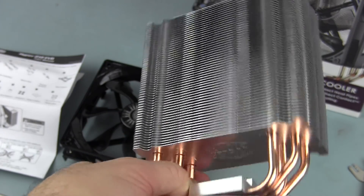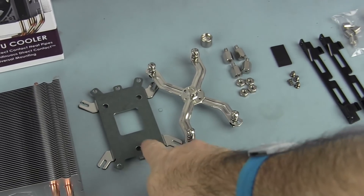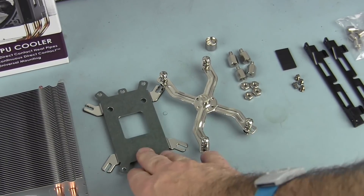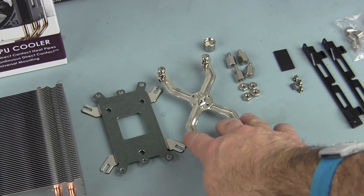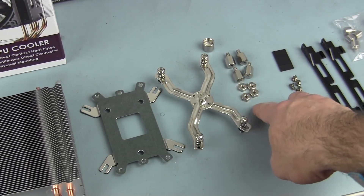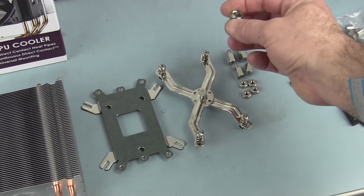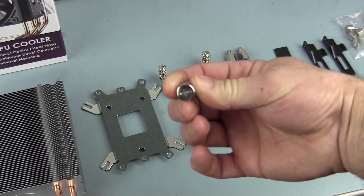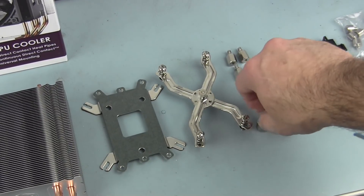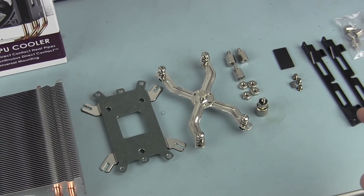Here are the key mounting pieces. This is your base plate that you mount to the underside of your motherboard. There's a bracket that sits through the CPU tower and holds it down to your motherboard. You get four standoffs and nuts to secure the mounting plate, and they also provide a tool that lets you use a Phillips head screwdriver to act as a wrench to tighten down the standoffs — it's the perfect fit for the standoff.